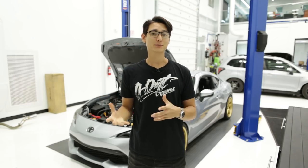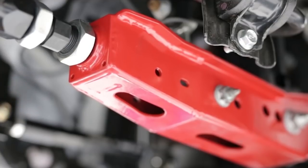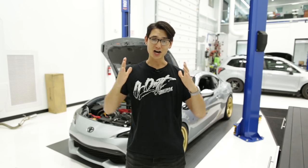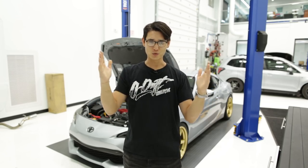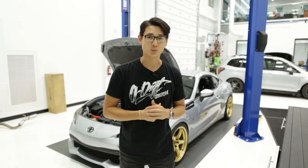For camber adjustment in the rear we have RSR lower control arms — those give you a ton of adjustability for rear negative camber. If you get crazy with your negative camber you will go outside the adjustment for your toe alignment, because the more negative camber you add the weirder the toe gets. So we also have our FT86 Speed Factory adjustable toe arms in there as well.